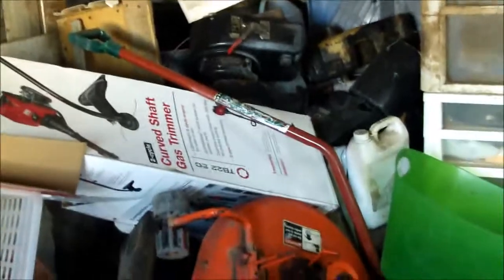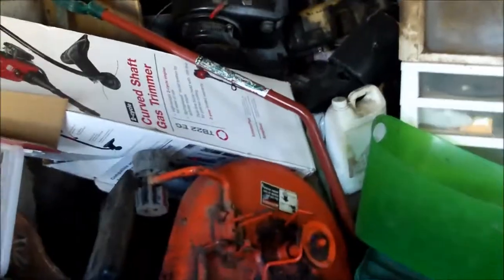I'm going to button it up and then put the tire on there. They ship these tires with a dip in them and they're hard to get on. I'm gonna have to get another tube — technically those existing tires would have worked but I just wanted the big tires. We'll get this Snapper going again soon. I'll have to hook up the throttle to the engine. I wonder if that Tecumseh cover over there would actually convert the Macy into a pull start — something to look into. I'm gonna take the engine off the Macy, put it on my bench, rebuild the carburetor, and try to fix the starter in a future video.